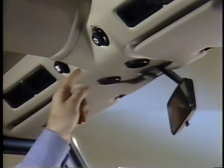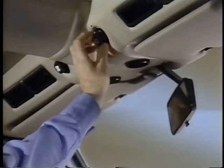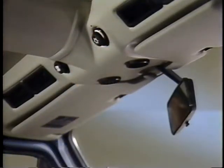Okay. The first thing that we should do is make sure that the AC compressor clutch is working. Now with the ignition switched on, we'll want to turn the system on here at the evaporator temperature control knob. Now turn the knob fully, and we should hear the AC compressor clutch click on and the radiator fan run on first speed.